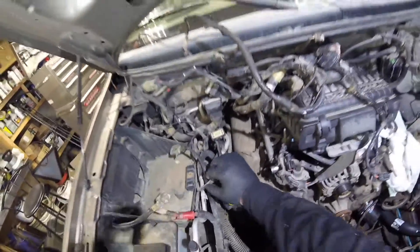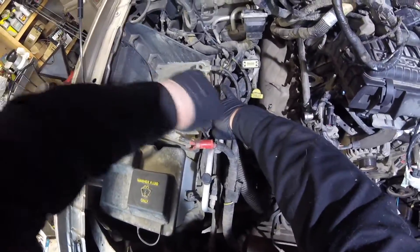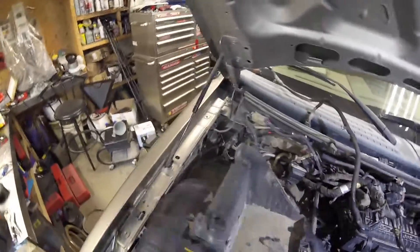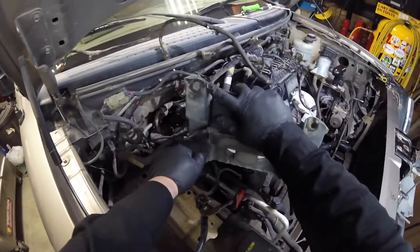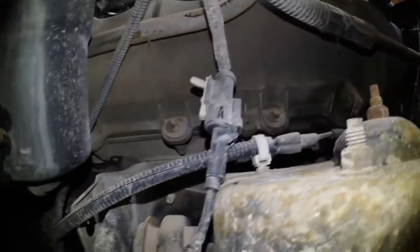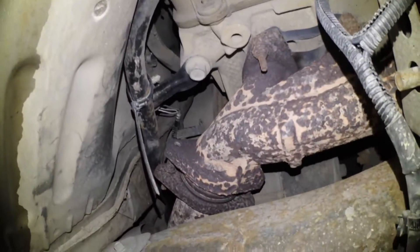We've got a wire connected right there — should have seen that earlier. There's one on this side too. There we go — battery tray. There's some sort of vacuum line here. I'll very carefully use that pick to bust the seal — there we go, battery tray's out. Removing the inner fender skirt is going to help you guys out a lot; it gives you way nicer access to everything down below. I'm just going to pull that transmission bolt out so the transmission dipstick can move around.